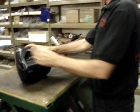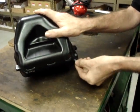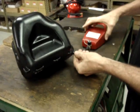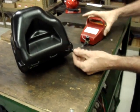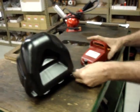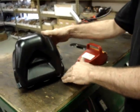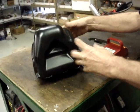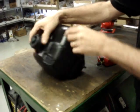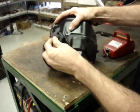What you would do is connect a hose from the output port on the fuel tank, and connect the other end of it to a vacuum pump. Now, this is just an air conditioning vacuum pump. Then you hook an airline to it. It is then pulling a vacuum on this tank, which is trying to squeeze it shut. You'll control the amount of the vacuum by opening and closing the vent.